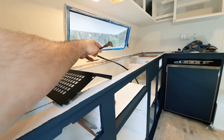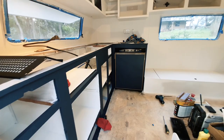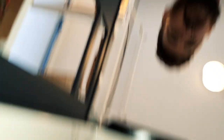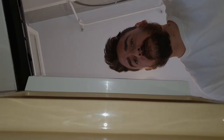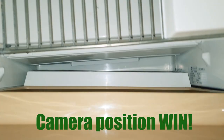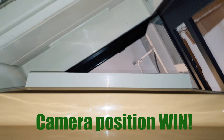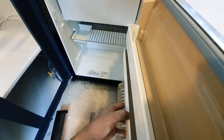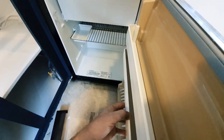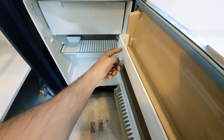Another mini project - I just want to see if this drawer hits that freezer thing and closes it shut, because it's got a gap at the moment. So that definitely doesn't touch - there's like a 10 to 20 mil gap between this and this. Two ways I can fix that: I can go and buy a fridge seal and get better springs, or I could just put a section of foam tape across the front to literally push that shut when it closes, which might be the way to do it.